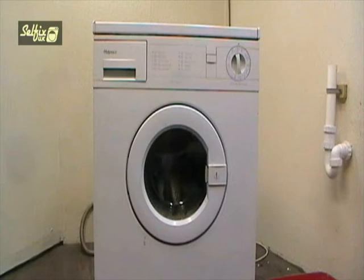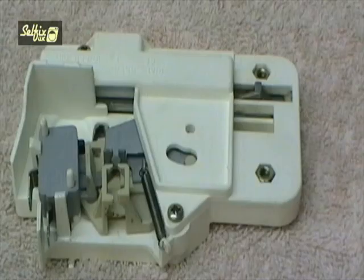Hi there, this video is about the interlock on a Hotpoint WM11 washing machine, or to be exact about how the interlock works, which will include the pecker system and the safety diaphragm linked to the pressure chamber. It may very well differ in appearance from the one on your machine, but if it has a pecker assembly attached, then the basic information should be the same.